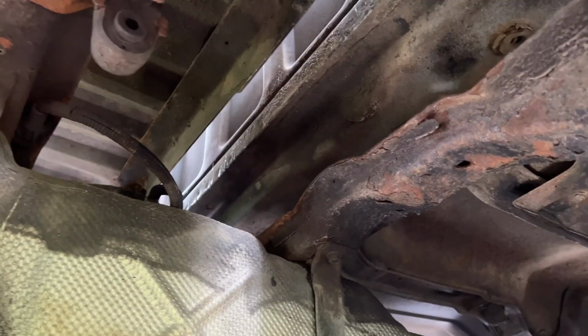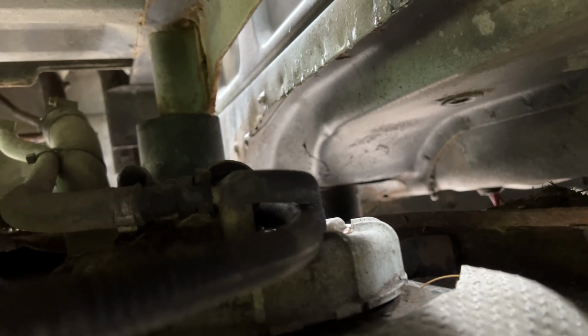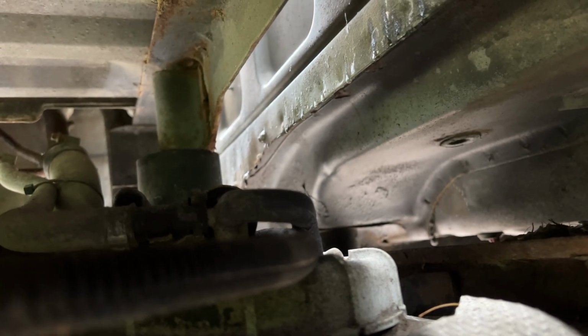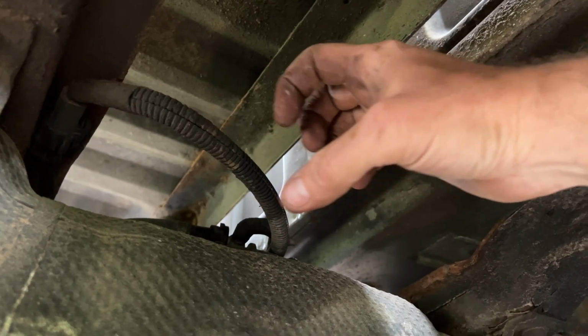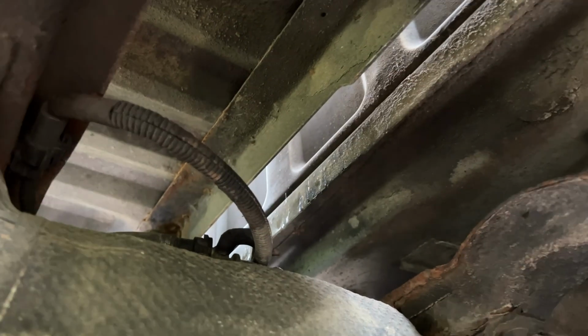But really make sure you don't hit your cab. So if we take a look up here, see, there's the fuel pump, there's the ring. So what I'm going to do is just undo those fittings, take off the electric. First though, I want to blow off all the dust. So we're going to blow out this whole area, clear out all the dirt and debris and stuff so that it doesn't drop into the tank.